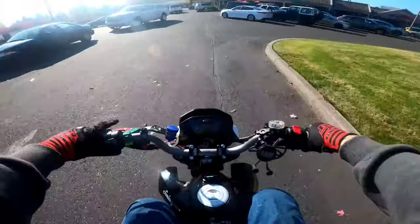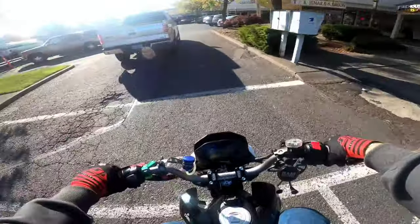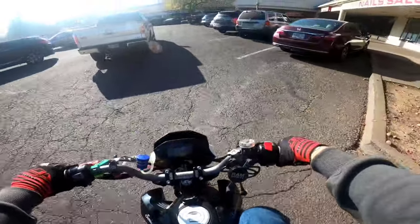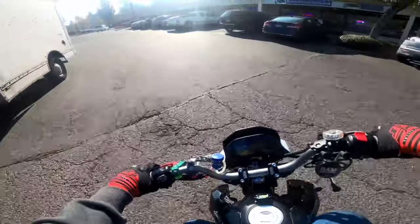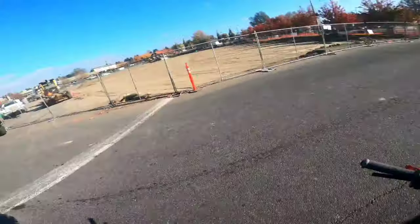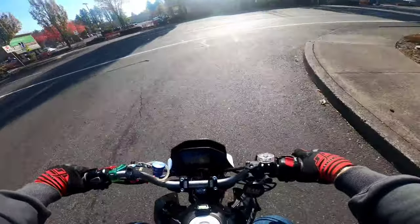Hopefully it's good. I'm tired of being the slow Grom. I mean it was still pretty fast — it's just a stage two, I just had the cam in it before. But I had to put this piston in because it just takes away all the bottom end. It's just a turd anything below 6,000 RPM — it felt like it was almost bogging, but I know it wasn't.